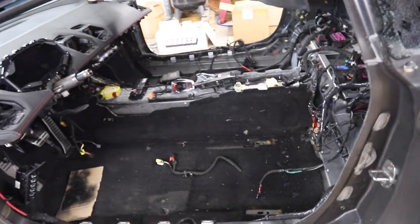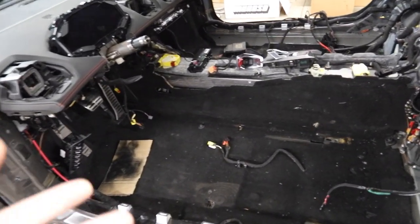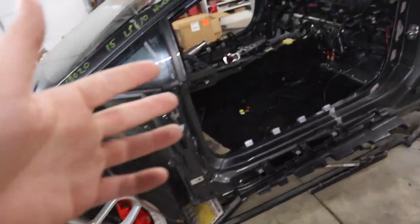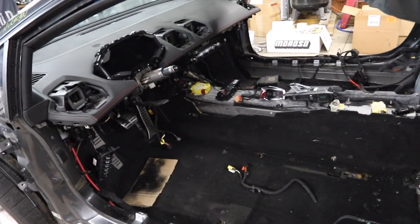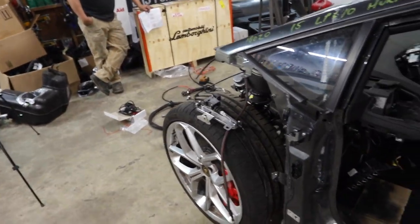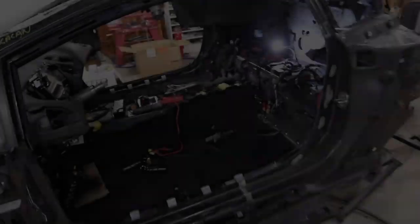You won't be able to start the car at this point because anyone can walk in and hit that button once — we don't even have keys for this car. So you can turn on the ECU but you won't be able to start the car. What that means is we need to power on our Huracan, hit button press one, find a wire that is dead when the button is off, and find that same wire that comes alive when pressed. We can tap into that wire and run it as our signal wire to the ECU.